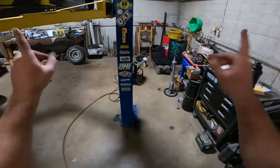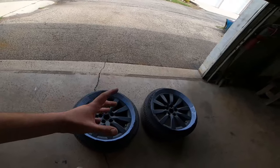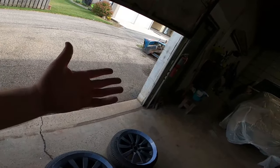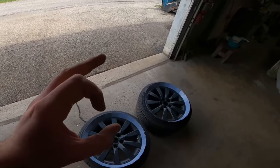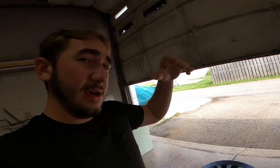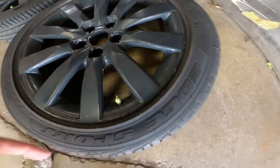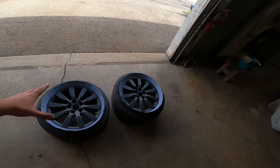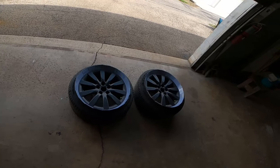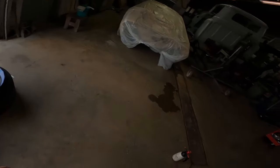All right guys, since then the wheels have all been scuffed, pre-cleaned. This is the method I've been using for quite a few years for painting wheels. If you don't want to have to pop the tire off the wheel, you definitely have to mask off the lip and make sure no paint gets in between the wheel and the tire - that little void, that little gap. The pain in the ass that it is to mask this off - just get playing cards, lay them in the lip of the wheel and it'll be perfectly fine. These two are ready for paint. I only have enough playing cards to do two at a time, so we'll do these two, let them dry, do the second coat, let it dry, pop the playing cards out, and then do these wheels.